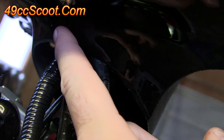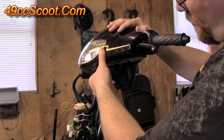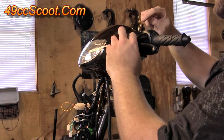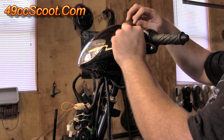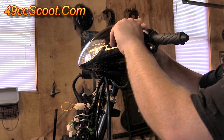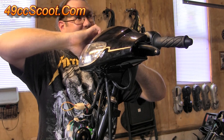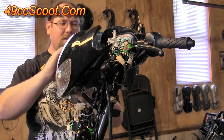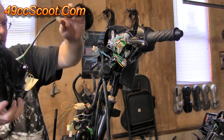Now I want to take this headlight fairing off. You've got a bolt here with an 8mm hex head — not this screw here, the bolt — and a screw here and a screw here. Remove all of those. Once you get the screws out, pry the bottom out a little bit. There should be a few clips across the top, so put pressure down on the back piece and lift up and out on the front piece and they should unclip. Then pull that out, disconnect the connector, and set this aside.